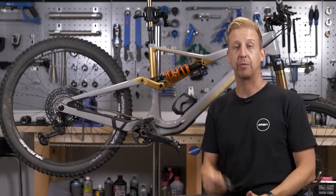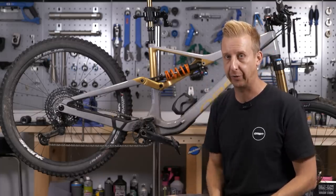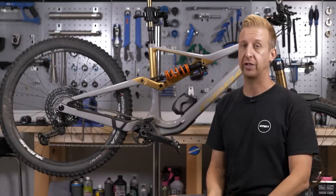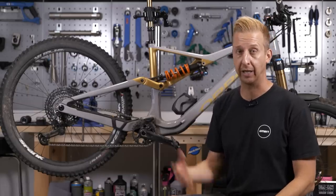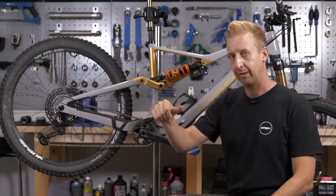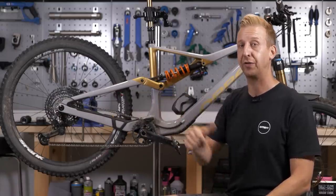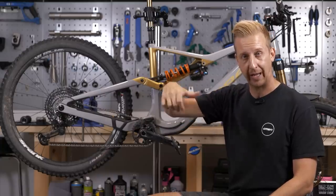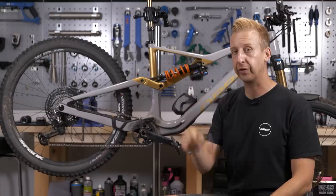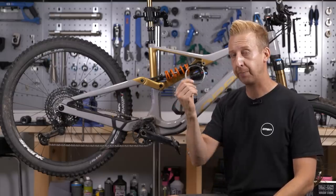The third option is to replace both the inner cable and the outer housing. I know riders that replace those annually without fail, just because they ride in such wet conditions that by the end of the year the shifting is a little bit sticky with some friction. Remember how light the action is on modern-day shifting — it should be really easy, with no effort to push the shifters at all. It's a very cheap job, and it's always worth keeping a few spare cables at home.